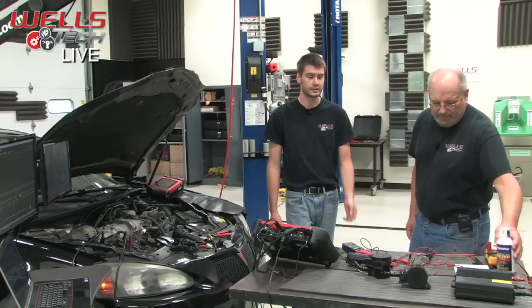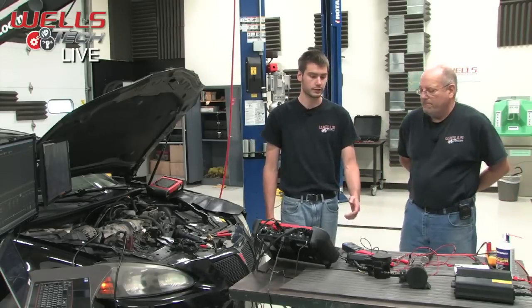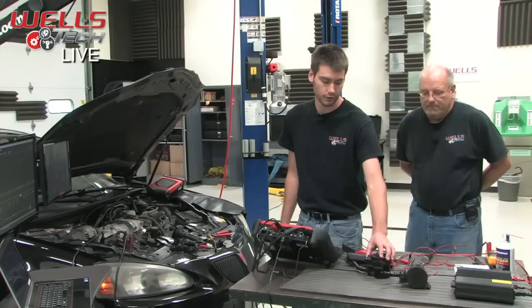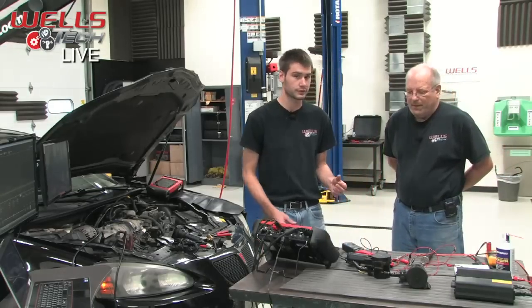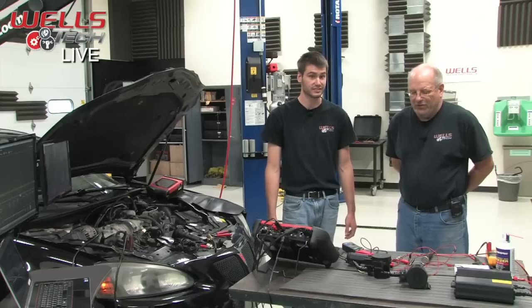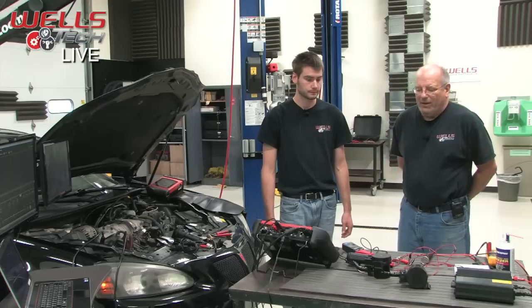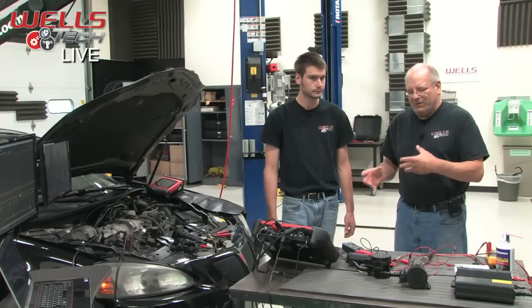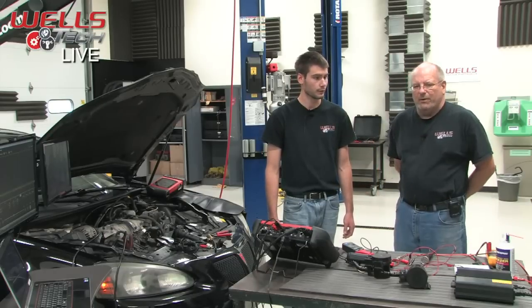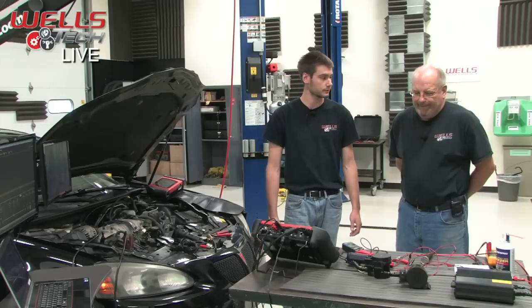And there's the TSB out there for the Silverados and such in the mid-2000s where they actually recommend replacing the vent solenoid with a kit that includes a filter that you're supposed to remotely mount so that the dirt doesn't get in there. So the OEs are thinking that way too. They're thinking it's a dirt problem, but I would still think you've got to be able to reproduce that. We've done testing upon testing here and have not been able to recreate the problem.